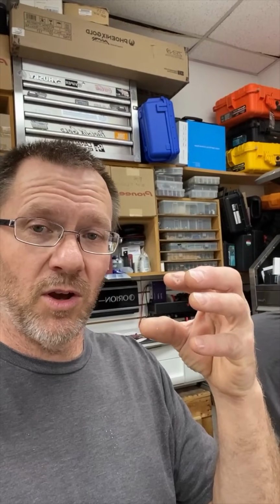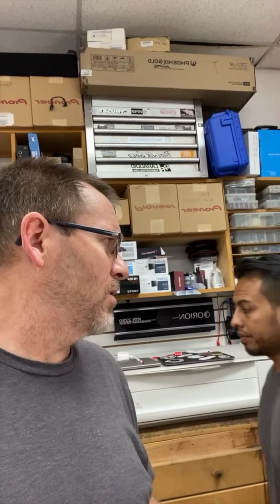What type of speakers should I set up my 2018 Honda Accord doors with? Honestly, most of the Accords we've done, we've either put Focal or Morel in, but I think Morel might be the most popular out of the bunch. The Virtus is really nice because you don't have to modify the door to fit it, because of the way it uses that neo magnet that goes into the small cone in the back. On the Honda Accord, you don't have to cut the door for Virtus, right? No. Yeah, it just goes right in.